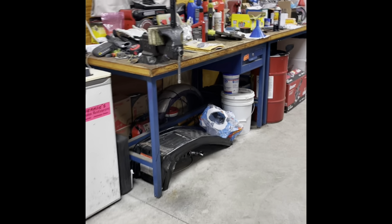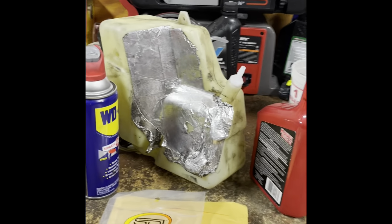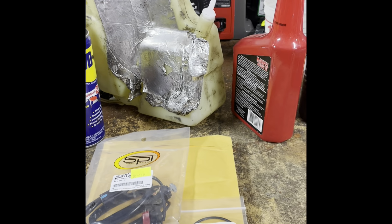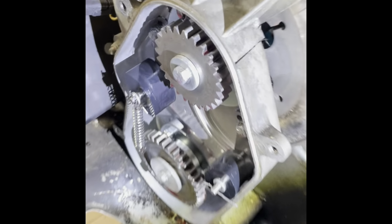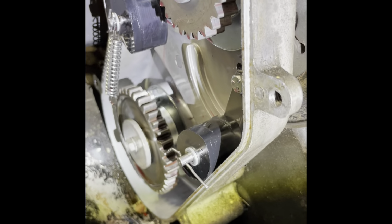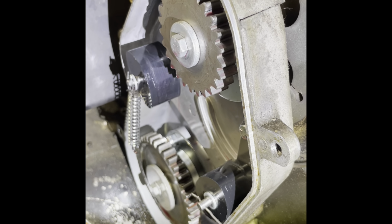There's a measurement here in the book somewhere. I'll finger through that once I get that apart. See what that's supposed to be before I see where it's sitting at before I pull it apart. All right, threw a straight edge on here. This thing's out pretty far. The upper sprocket needs shimmed out. I'm gonna try to see here.